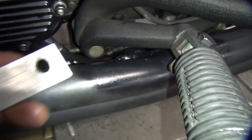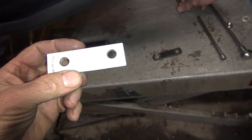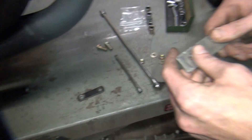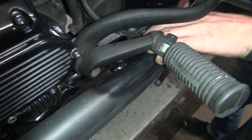We also re-welded the pipe up here where it wasn't really welded to the pipe. They did a nice weld on top of the bracket, but they didn't weld it to the pipe. We've got those two 3/8 bolts we're using. We'll leave the finishing for later — you can paint it black later too. Let's just go ahead and bolt that up in there and see how it looks.